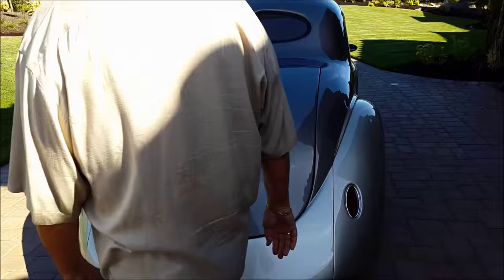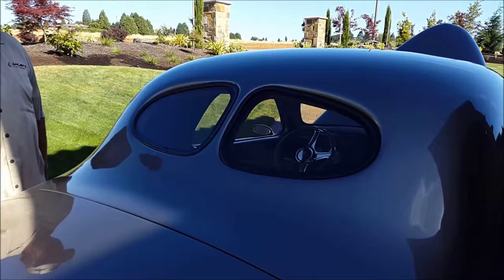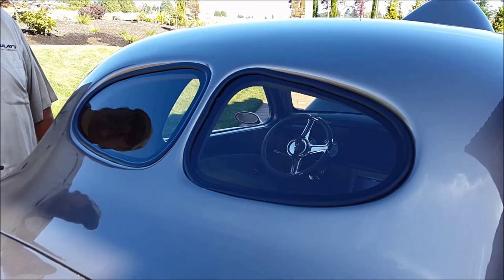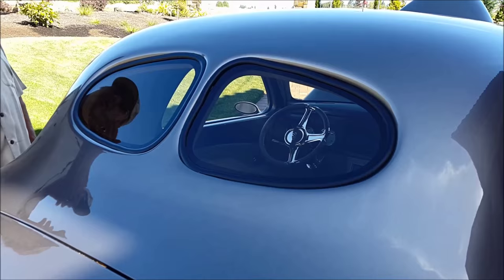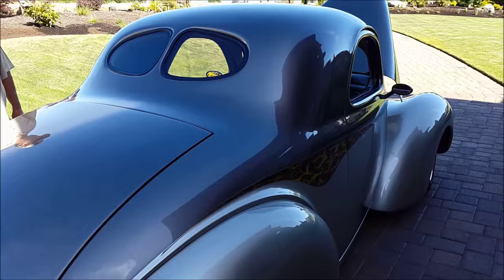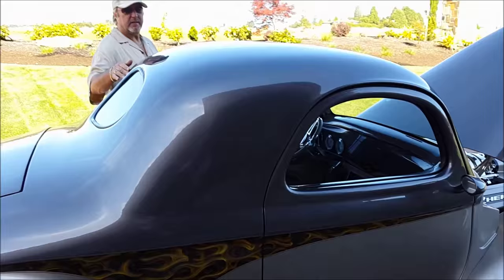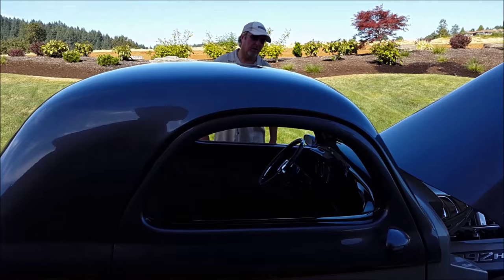You can see the profile where the top has been chopped about three inches. We spent numerous hours fitting and redoing the body to make the windows fit symmetrically the same on both sides. A lot of these cars when they were built new were never this well-fitted, so it really flows well. All the glass is tinted a real light bronze, and we spent numerous hours making patterns to get that fit in a color that would look rich with the car. These are maintained weather stripping and window surrounds, so it all fits real smooth — all modern window trim.